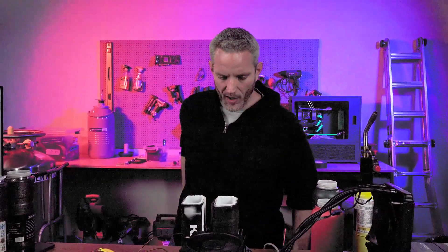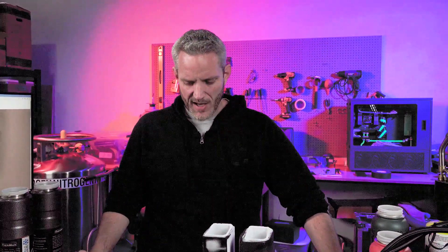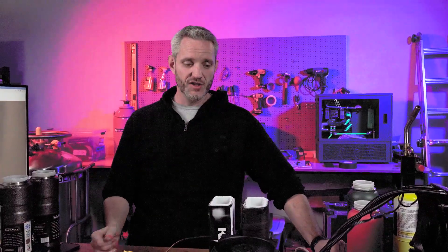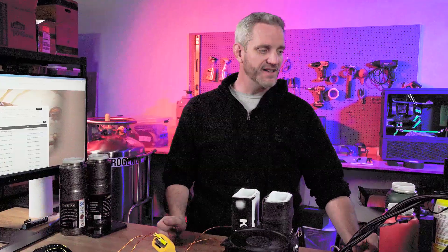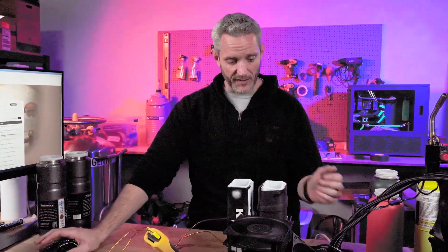I'm going to warm up these cards and get them off the test bench before they turn to water. We'll do this again — I only have the tank for so long before it all burns off — so I'll do it again maybe next week. Now that we didn't have to spend half the day putting it together and figuring out why it wouldn't boot, considering it looks like we had a bad SLI bridge. As soon as I put this one on, everything was fine. It's also completely possible that the reason why I'm getting weird crashes at the lower frequencies is we're starting to get ugly power because we're still only running one power supply. I'm pretty sure that's what's holding me back right now — asking for more voltage and the power supply can't give it. That's why we're getting crashes at a certain limit. I need to get both power supplies running so I can make sure each card is getting clean power.